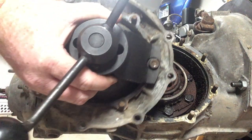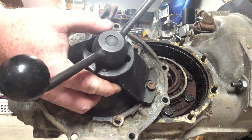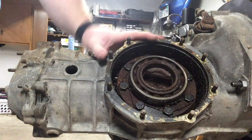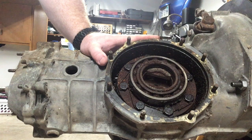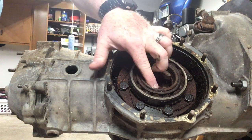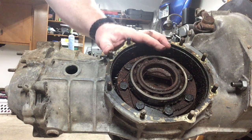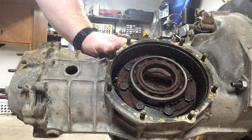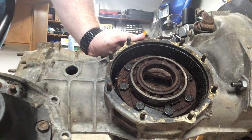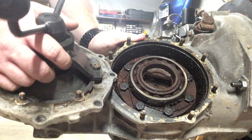You can make your own version of the factory tool using a flange — put a bolt there, put a wrench on the bolt head, and you just need something circular that drops in. It could even be a couple of big washers stacked together with a nut on the bottom end of the bolt that pushes against the washers. It's not a ton of force to get this in and out, so there are a lot of options.